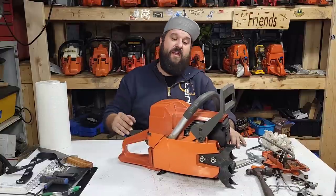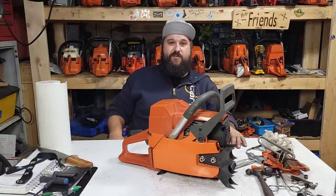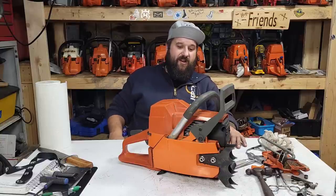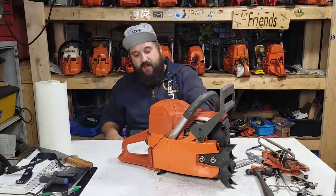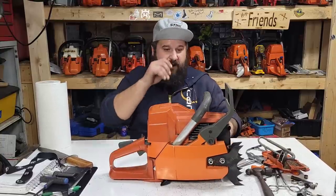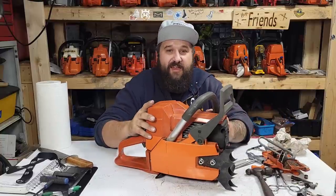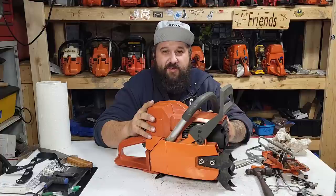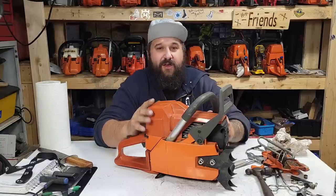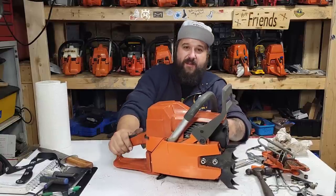Now, moving on. The part that scares me the most in these is the crankshaft. The cranks are pretty soft in these, friends. I have ported saws back in the day with Farmertec cranks that I built. They didn't last very long. The crank stretched. Often the crank will stretch and or the bottom of the rod will fail. And that's a catastrophic failure. You can wreck cases and top ends and bearing pockets.